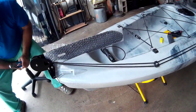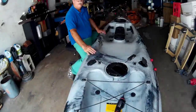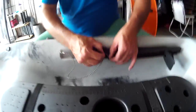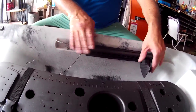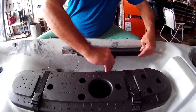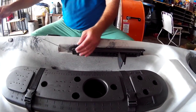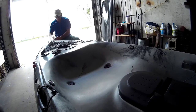Next step is we're going to adjust the steering cables. The steering cables leave the rudder inside the holder, and there's plenty of slack left over here. I don't like cutting off any excess yet until whoever fine tunes this. Always start with this thing centered. The pedals — by squeezing this you adjust each one later. For now, put furniture polish on there, it makes them easy to move around. We need to take up the slack — we have a lot of slack here, so I'm going to come back here and give this one some slack so that they both have about the same amount on each side.